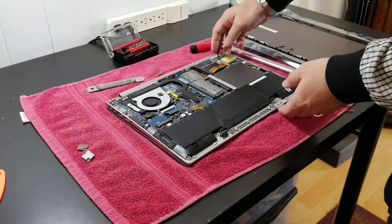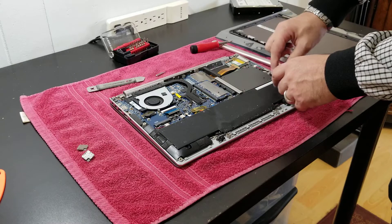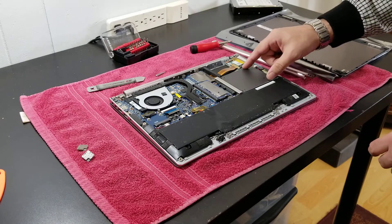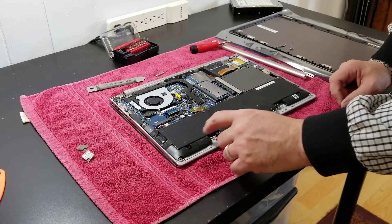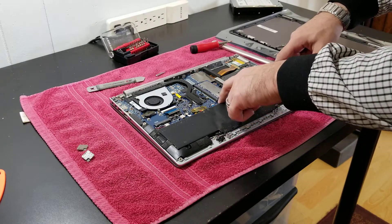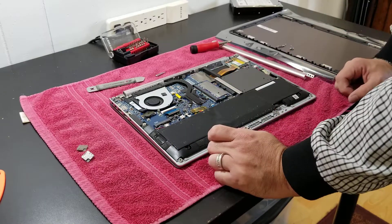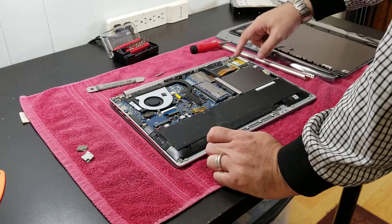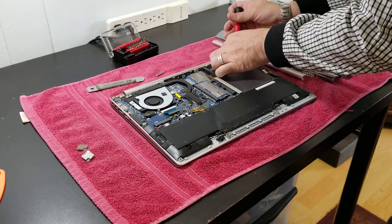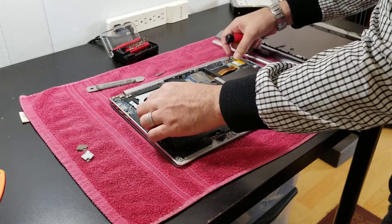So if you just want to replace the hard drive, here's the hard drive - just unscrew this and here also, and you'll be able to free up the hard drive. Or this is the battery - also easy to replace, just one, two screws here, another one here, another one here, and that's the connector. In this case I'm going to be working on loosening up the hinges first. There's also the connectors for the Wi-Fi and the connector for the video display.